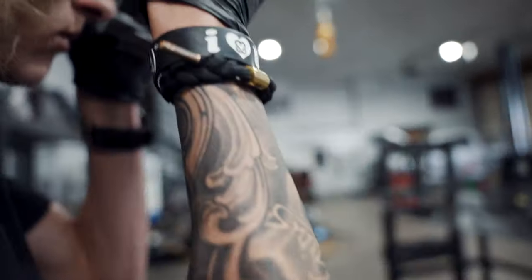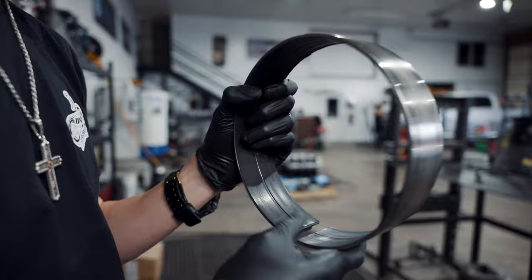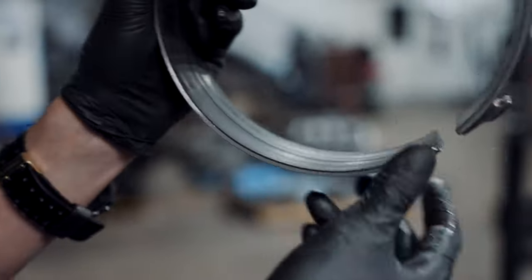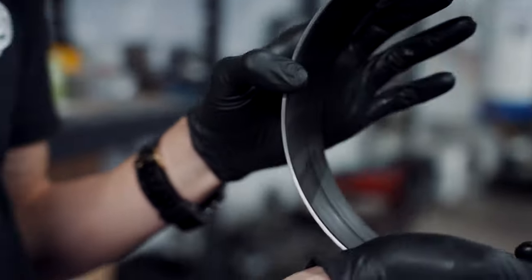And if you smell that, that's stanky. Smells like burnt clutches, doesn't it? Yep. But anyways, I kept putting in clutches in the direct drum. Well, the drum is slowed down by this billet band. Well, the band was shot, and I kept overlooking it because it had a bunch of transmission fluid on it.